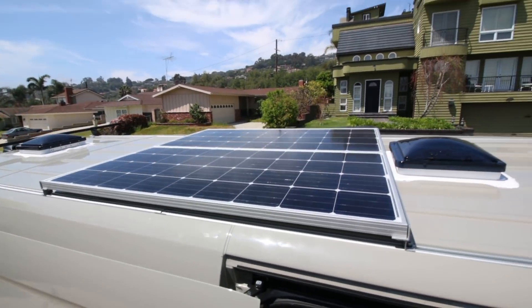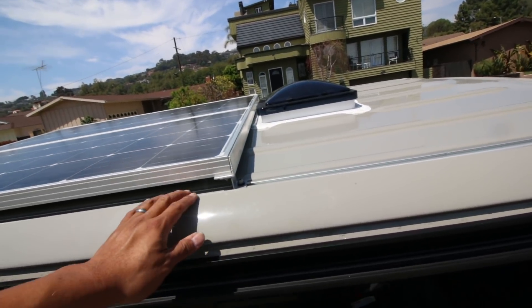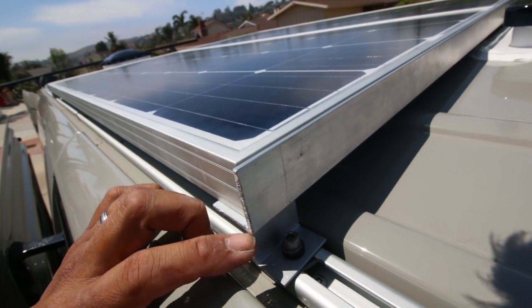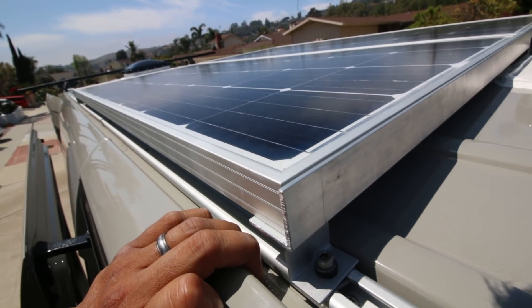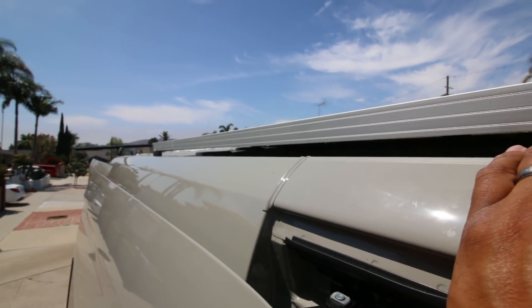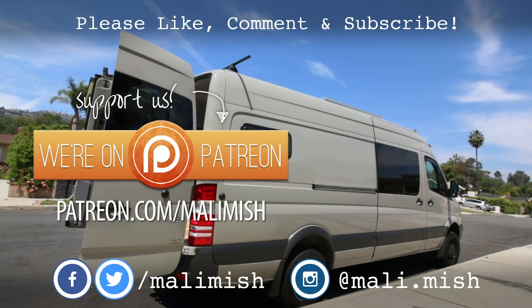There's the solar panel on the roof. I left just a little over an inch of clearance between the front and the front fan. You can see the assembly of how it's fastened to the rail — there's a little S-bracket and a track nut underneath, and then a 6mm stainless hex bolt goes through with a washer and also a rubber washer that came from Yakima. The wires are underneath and I need to tidy that up, but other than that it's a pretty low-profile, flush fit.